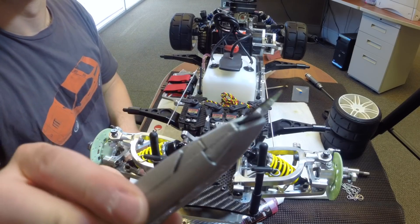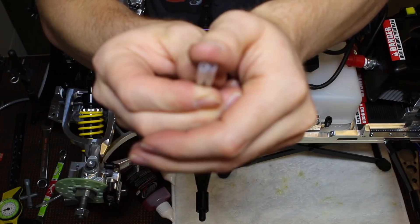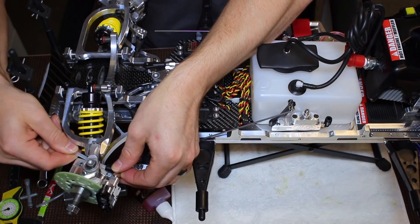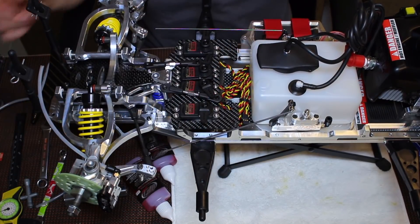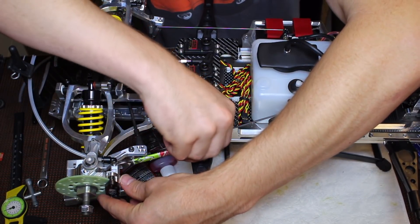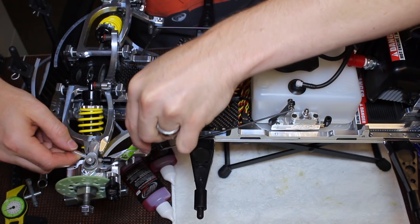Use a very sharp knife so that it cuts the line cleanly. Cut two angles that are exactly the same and make sure that the line isn't deformed in any way. Those just press fit into the little right angle connection. You'll feel them bite in as soon as they're pressed in all the way — make sure they're fully seated. Make sure they're tight, but do not over-tighten, because those little right angle connections will break off and then you'd have a real problem.